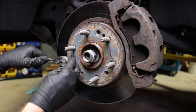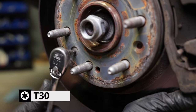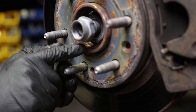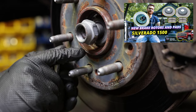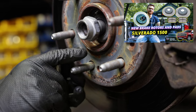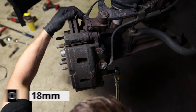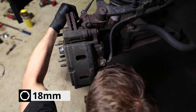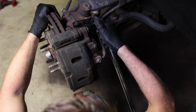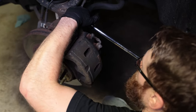I'm going to remove the holding pin from the rotor — this is a T30. If you want to know how to upgrade the brakes or replace your pads and rotors, we have a whole video guide up on the channel; we'll have that linked above and in the description. Now we're going to remove the caliper, held in by two 18-millimeter bolts which I'm going to break free first and then remove with the impact. You'll want to have a couple of zip ties ready so you can hold the caliper up — you never want to have the caliper hang by your brake line.